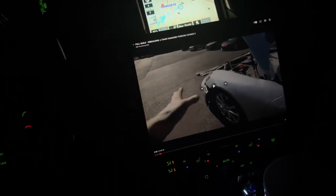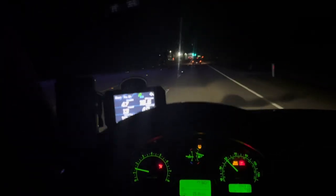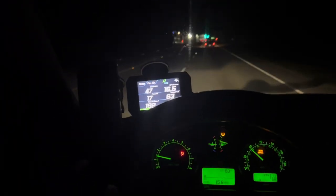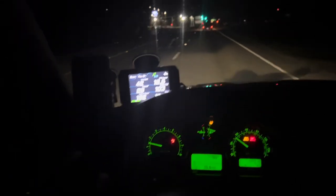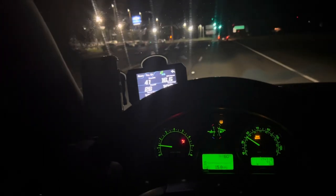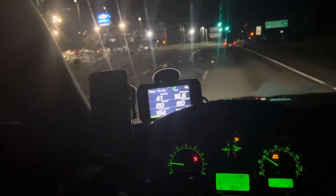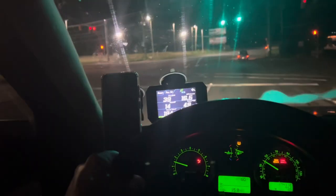But right now it is set on high, but the thing about it is there is no thermostat, so water is circulating freely anyways. So that is that. So that's going to be inaccurate. I mean, now we've got some regular type of driving here. Temperature is like 194, which is about what we're getting with AC being on.